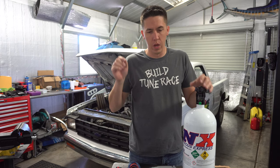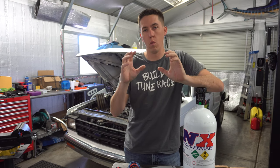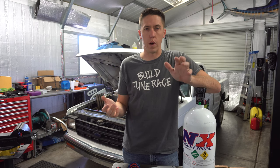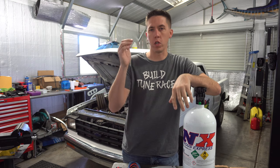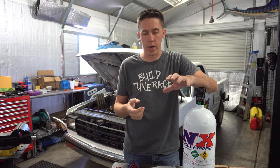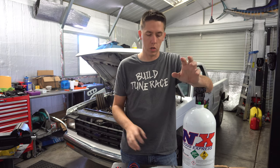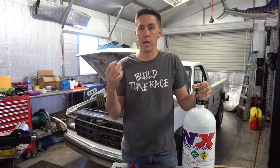I'm thinking I want to set this up so that in the window where the truck bogs down, the nitrous helps get it into the higher RPMs. I have a feeling once it's in the higher RPMs making power, it won't bog - it's just that weird transition state. So I'm going to spray it somewhere between maybe 2,800-3,000 RPM up to about 4,500, then have it turn off. Then I can have the next stage on a button if I need more up in the high RPM range. The Holly lets you set window switches so it can't activate above a certain point - so you're not hitting the rev limiter with the nitrous on.